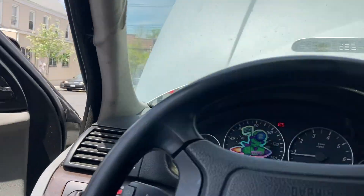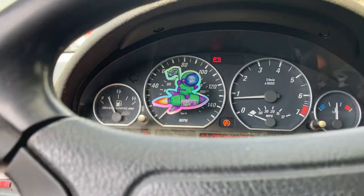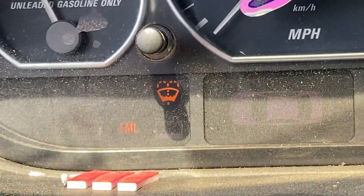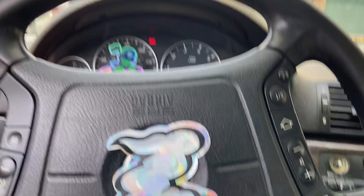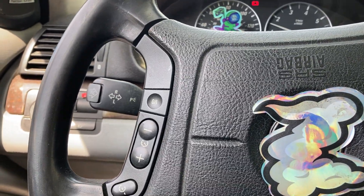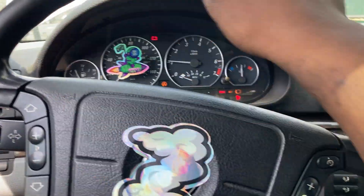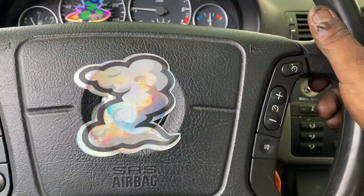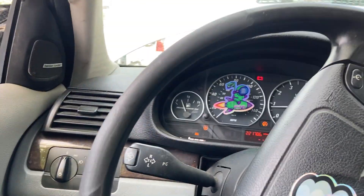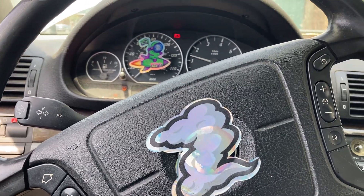It runs — it's actually not that bad — maybe because the air control valve is still connected. But the problem now is it literally cuts off at around 1500 RPMs. I didn't stop revving it, it just cut off. It's in limp mode, so the car can move but it doesn't go over 2,000 RPMs. That's weird.